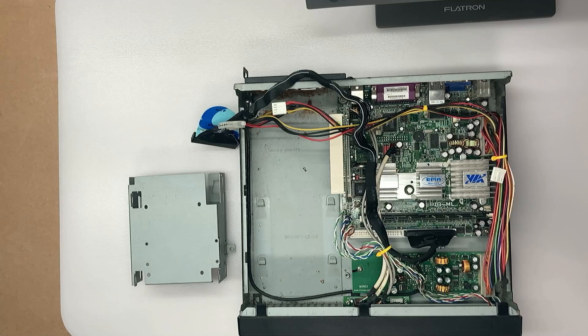With the backstory out of the way, it's time to get this build done and boot it up. It's pretty straightforward with these mini-ITX boards — you only get one stick of RAM, and for this build I'm using a 512MB DDR400 stick, which is a bit of overkill, but I don't have anything smaller or slower. The CLE-266 will only run this memory at DDR266 anyway, but that's okay.